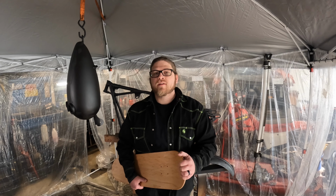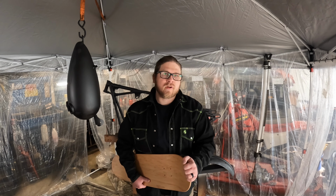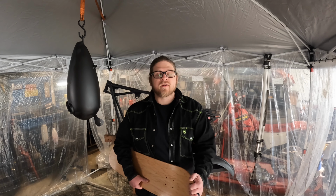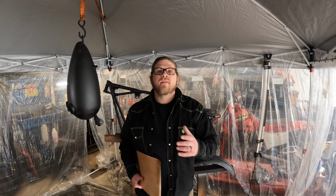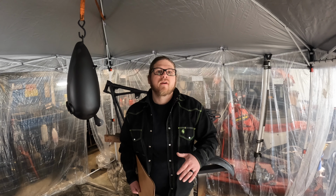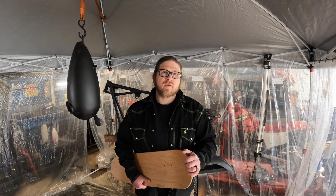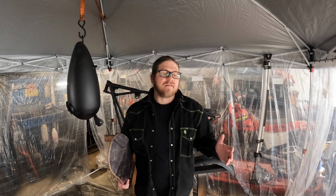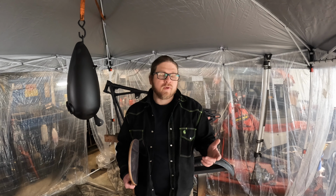Today is the next installment on this chopper build, and that is going to be getting the components into a high build primer. Last time on this bike, we took care of the body filler and smoothing out some areas. By the end of that video, I was able to get everything shot back into epoxy primer, so it's sealed up from the elements, no matter how long it takes for me to get back to this bike. Now that this has dried and gassed out, I'm able to take that next step with the high build primer.